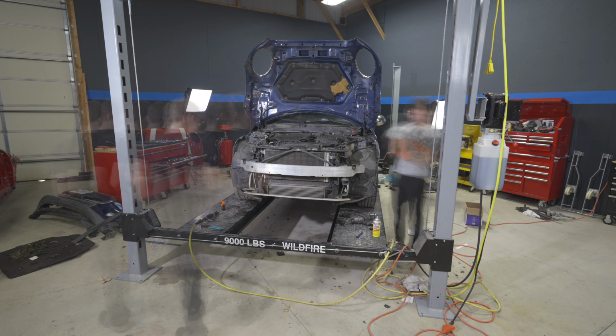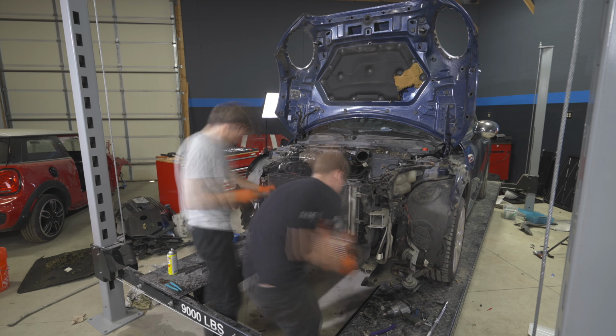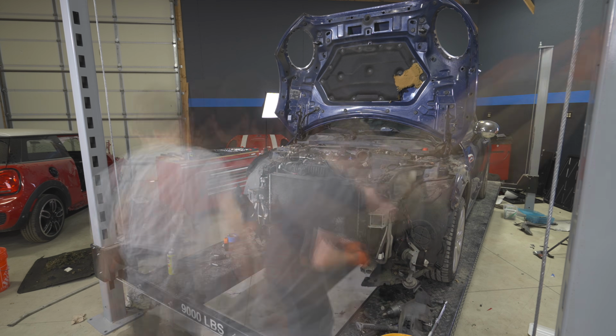We then continued to take apart the car by removing the headlights, then the crash bar, then the air filter, and then we were ready to empty the coolant, if there was anything left. Alright, so we just removed the air condenser and now we have to get to the radiator. In order to do that, we just have to empty one of the hoses, pour it into a bucket, and then we can take off the radiator and drain what's left of the fluid into a catch can.